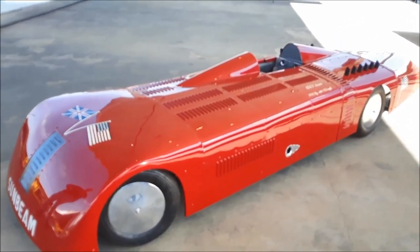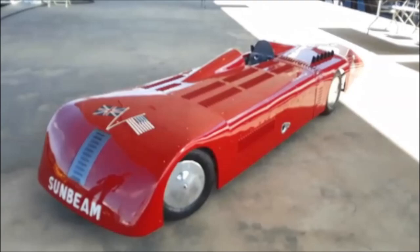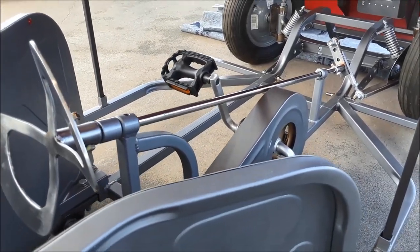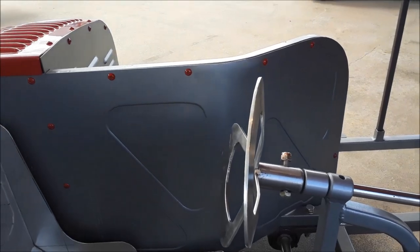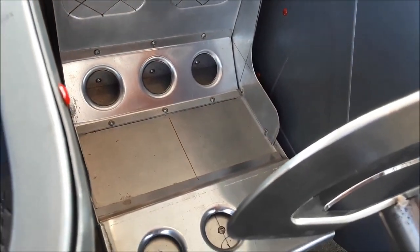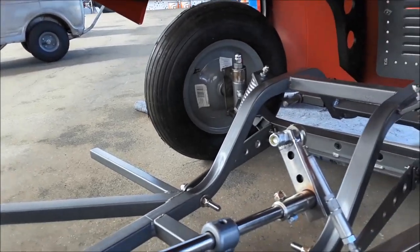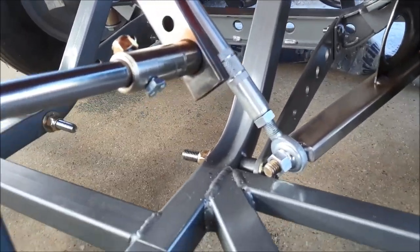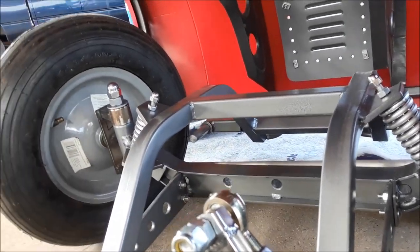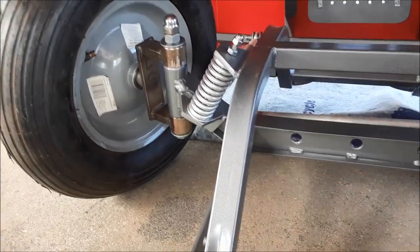The whole front nose lifts up and you'll see all the workings. The steering wheel is all hand-cut. Now look at the pedals — this is almost like a recumbent. You're using rivets. Look at the details of the seat. This is not modeled after the original seat. There's the steering right there — it's a drop front axle. And it actually has three degrees of positive caster, so it steers easily. Those are valve springs — from a big diesel.